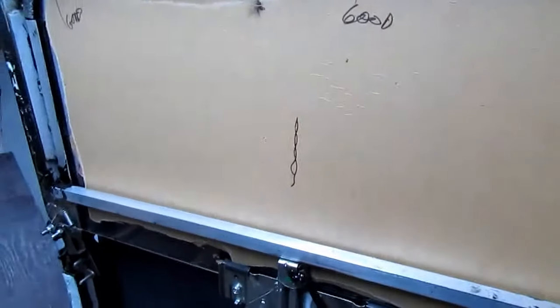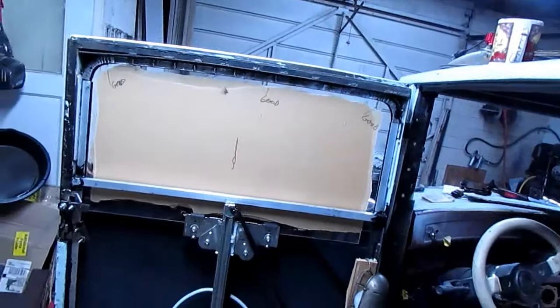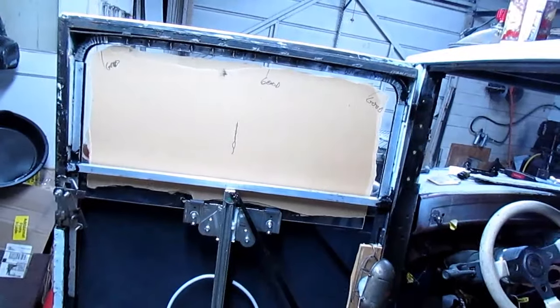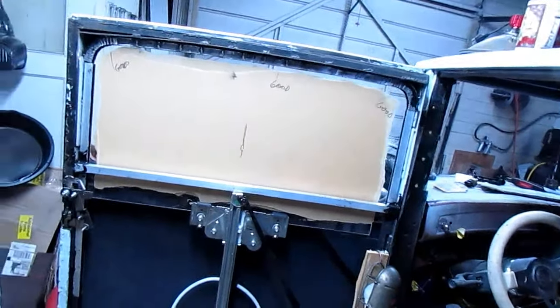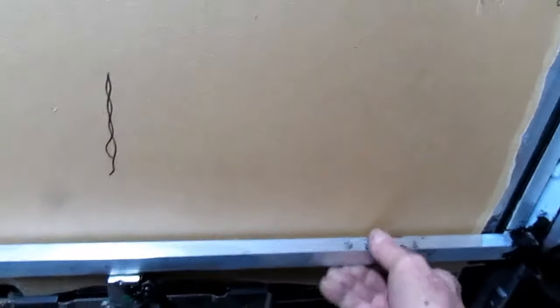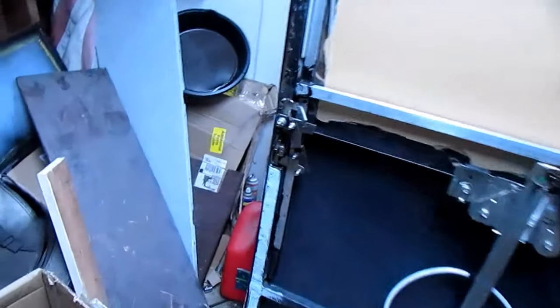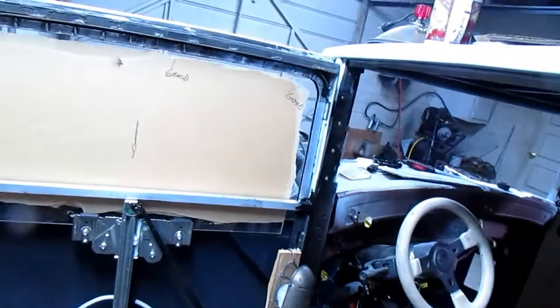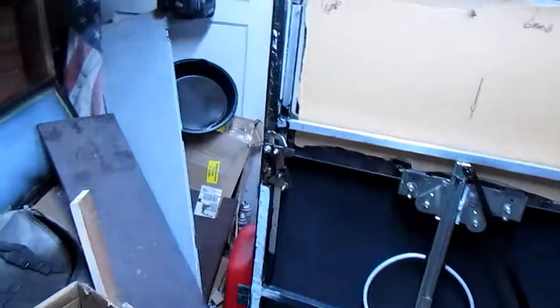I'll leave this up for now. I don't think it really makes any difference because the glue's pretty much dry. It'll be dry completely tomorrow. I think it took four to six hours before you're supposed to be able to move it, or put it on glass before you can drive the car, whatever. But it looks like it's plenty strong. Of course, to get the window out you'd have to cut the glue on this, but with a long razor knife and a little bit of heat, you can get them out.